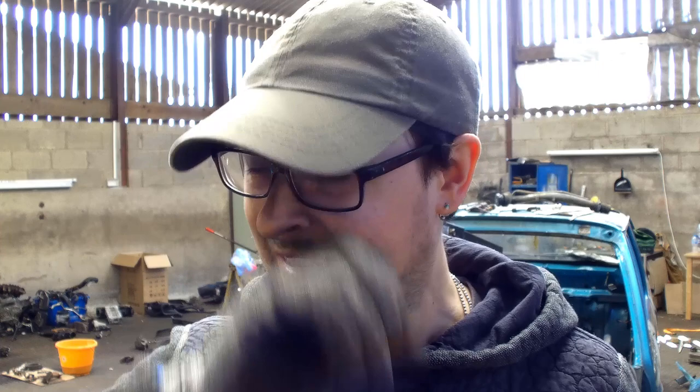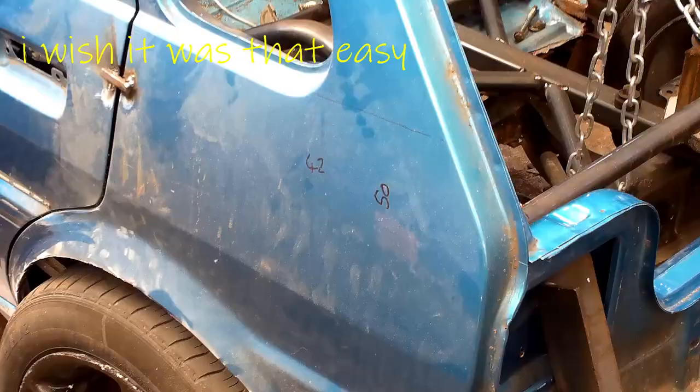As you can see, we've got both sides now with the bracing ready for making the bracket to hold the shock absorber. I'm going to run a tube probably down from the side of that to the chassis so I know it's nice and secure so it can't move. So what we're going to do now is come away from the car and mock up and draw out the best sort of design for it. I can't bend a nice U-shape on the bender, so we're going to have to come up with a different design. Both sides are about 99% the same — not perfect, as the bender doesn't exactly bend things perfectly every time, so one's slightly more deformed than the other. But that's going to be the nature of the car all the way. So now we're going to go to the bench and mock up what we're going to build.